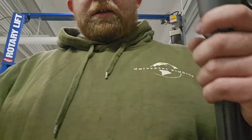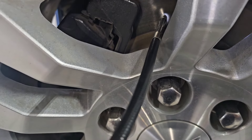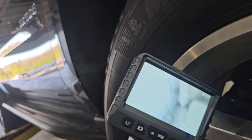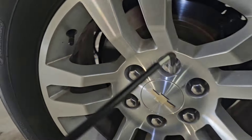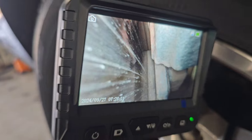This is really cool and the quality of the camera is phenomenal — it is absolutely phenomenal. Let's pull the vehicle in so we can see how it looks inside an engine. You know how sometimes when you're inspecting brakes you can't really see the thickness of the pad? I've got the camera set up using one hand — I'm going to stick this in here and articulate it. Now I can see the thickness of my brake pad right there. That's probably a good 50-60 percent plus, so these brakes are still good.